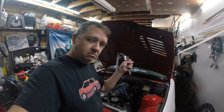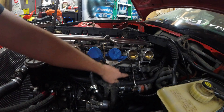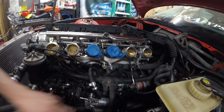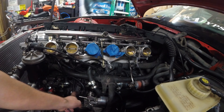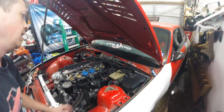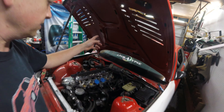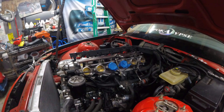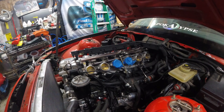So let's grab that fuel line and bend — look at that, with the right tool that took all of two minutes to make correctly. Now all I gotta do is bend that over so that it'll reach our fuel filter and then that line will be done. Then we'll just run a rubber hose to here and call that done as well. It's now in correctly and the throttle's clear and we have no issue. So let's finish bending this line so that it can run the right direction and not into our throttle cable.